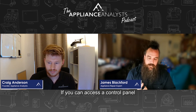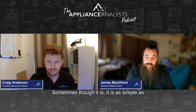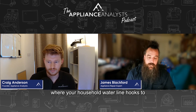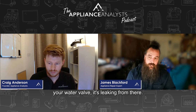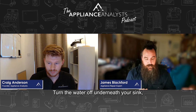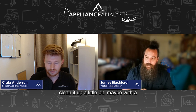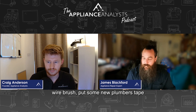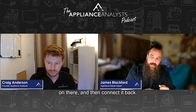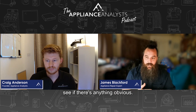If you can access a control panel and remove it and look under there, sometimes it is as simple as where your household water line hooks to your water valve, it's leaking from there. So that may be as simple as turn the water off underneath your sink, unscrew the water line, clean it up a little bit, maybe with a wire brush, put some new plumber's tape on there, and then connect it back. That may stop your leak. So definitely look under there and see if there's anything obvious.